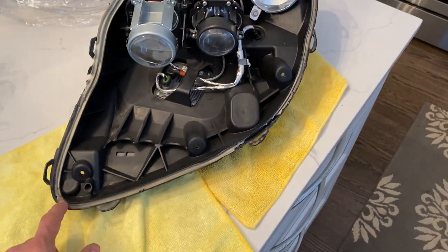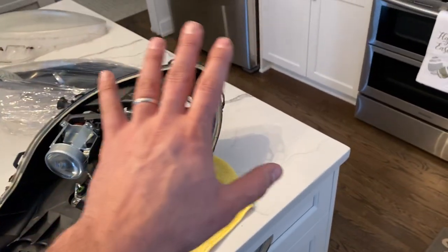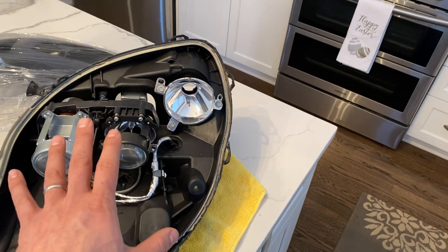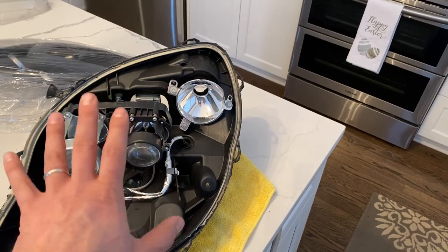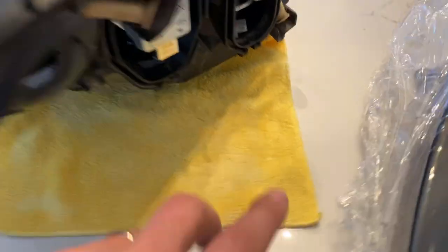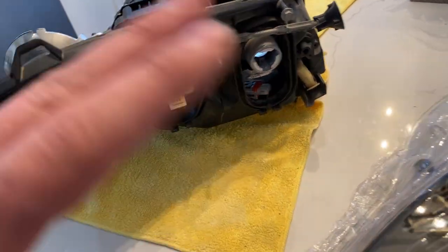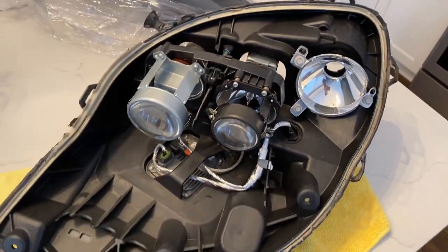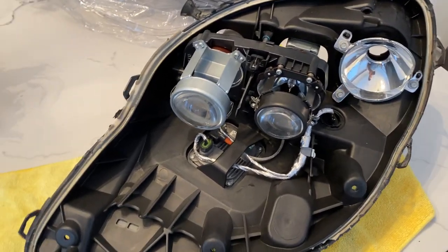Most of the time it's not going to be as easy as you think — you're still going to have to go in there and pry it open. The first cycle, preheat and let it sit — it usually takes about five minutes to get up to 200. You can go to about 210, but that's really the limit. You're heating everything up — you want to remove your plugs since there's a lot of rubber and thin plastic everywhere. 200 degrees won't melt your tabs; they'll become soft but they won't just melt right off.